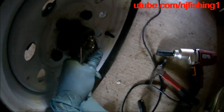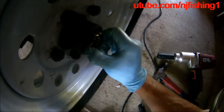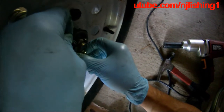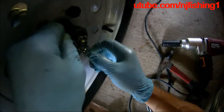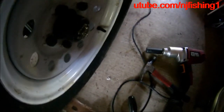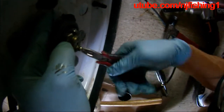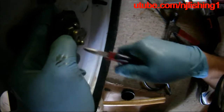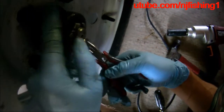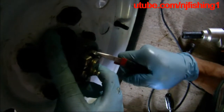That pushes the inner race against the spindle very tightly — it cannot go any further. So I'm going to unscrew the castle nut completely and then hand tighten the castle nut until it won't go, then back it off to this hole so the castle nut lines up to the cotter pin hole. Then I push the cotter pin through and bend it — that's it, that's how you do it. Push down and bend the other side of the cotter pin towards the castle nut as tightly as possible.